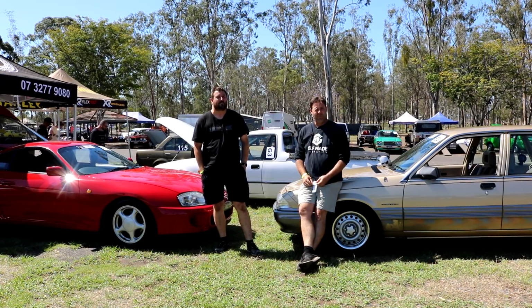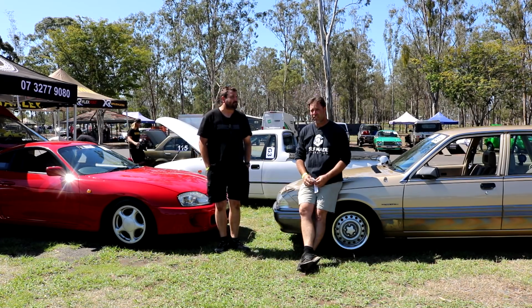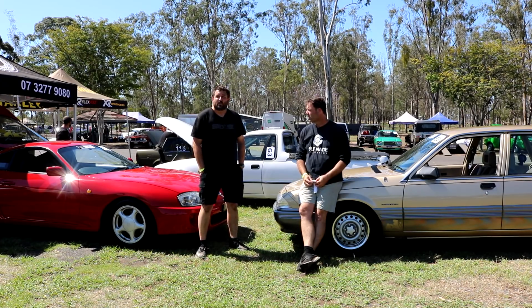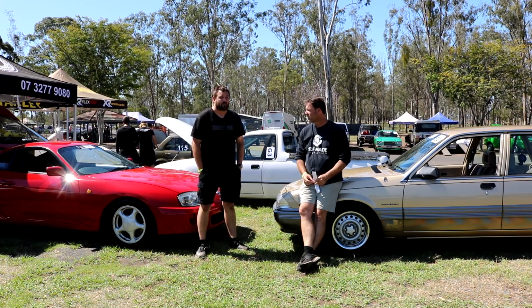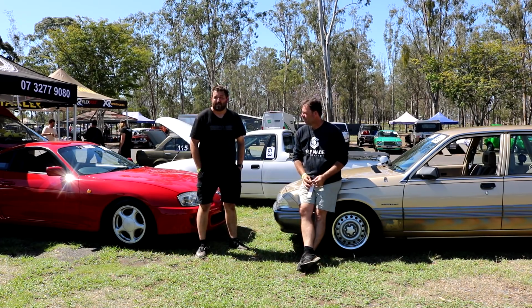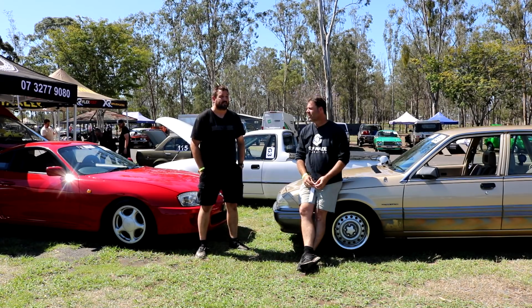Alright, so day one had three passes each. First ones were fails. The nitrous bottle pressure added up at 1500 pounds. So it's a hot day, and the solenoid just said, no, I'm not opening. So I had no nitrous. And so it went nowhere.